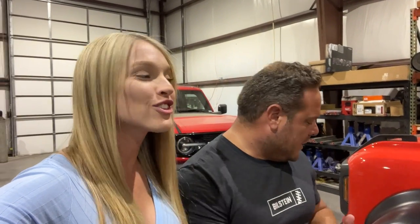We have a lot more faith that it's slightly less likely to break in the Bronco Raptor than in a regular Bronco. But it won't matter much anyway — we're going to go with portals from 74 Weld, plus the billet rack, and probably 40s. The portals are instead of going with larger axles — you can do axles or you can do portals. Either way, 74 Weld is making the billet steering rack.